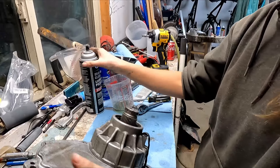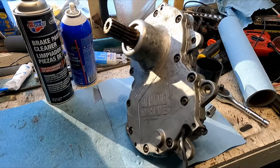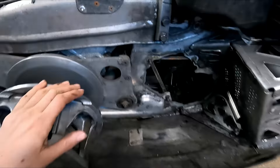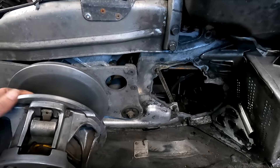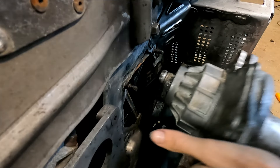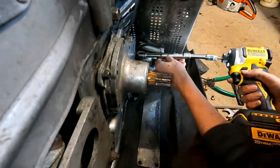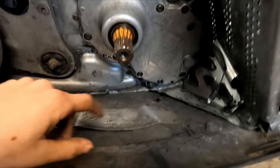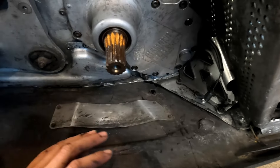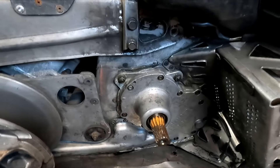It is the next day - it's absolutely freezing outside, about five degrees. Got the fire going in the garage. We're going to put the diamond drive back into this M7 right where it was. I put a little bit of lube on the shaft and it slides right in. We got the six nuts on the studs using the impact driver - hand start them, get them straight, then work around in a star pattern to snug them up. They're a half-inch socket, not 13mm like I was trying before.